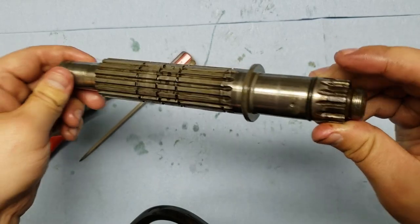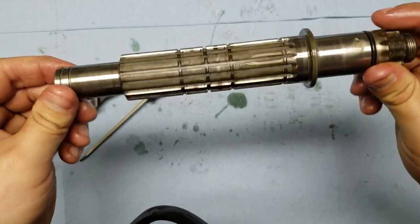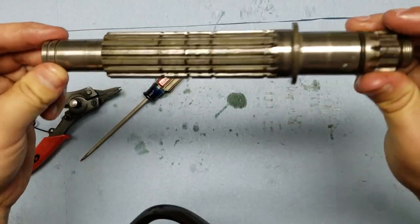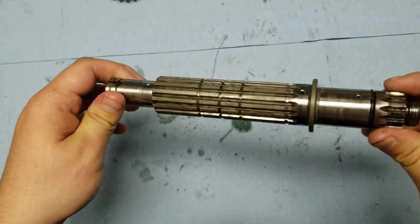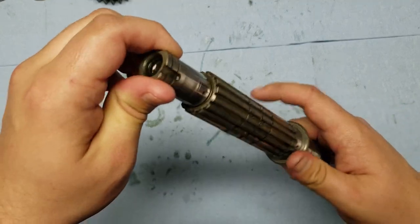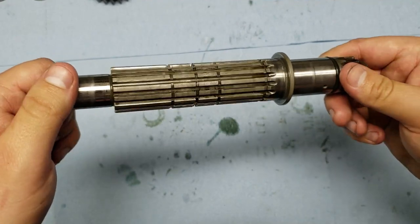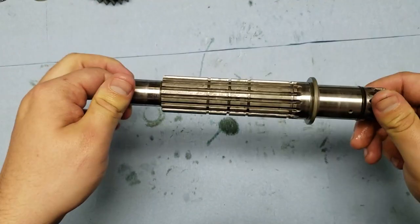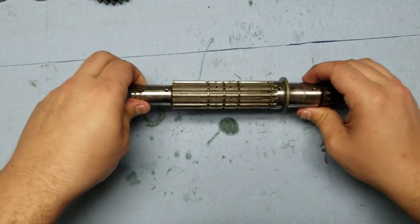I am going to be replacing this O-ring. Now I'm going to blow this thing out, clean it off with some brake clean, make sure the oil galleries are clean, and then start putting assembly lube on the gears and start putting it all back together. The gears and all the collars are all washed out and clean. I made sure to blow air through all of these holes to make sure I had no liquid left in them and the air actually comes out. So everything is nice and clean — all the grooves are clean.